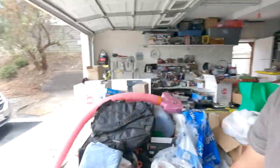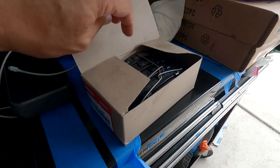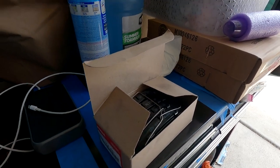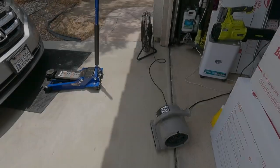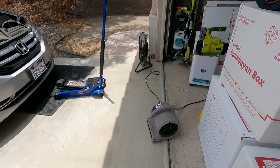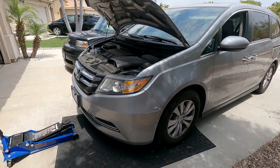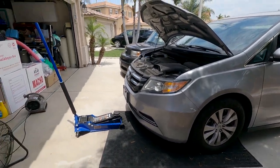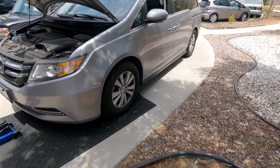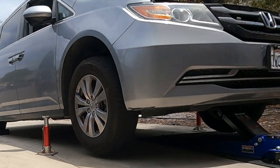I had to play some musical cars real quick — there's a little bit of shade on that side. Looks like it's the right part; it's for an Odyssey 2016/2017 — it's all the same. The rotor should be all the same but you never know. Got the proper setup going, got the fans going for some airflow before we start. This thing has a mean shake starting at 40 miles an hour when braking — pretty extreme. Rotors are warped. Looks like her brake pad percentage is still good but we're going to replace everything.